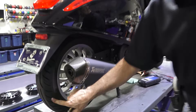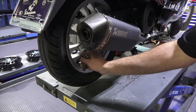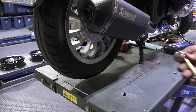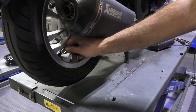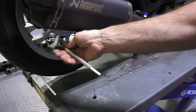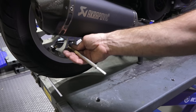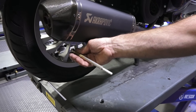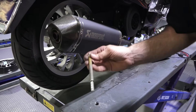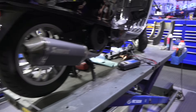I've got the part number for you. You've got the Schrader valve, much like a bicycle or a car. Unthread the little cap and just take one of these gauges and push it right on. It's got 26 PSI in it. On the nameplate it says 36. I tend to like to run about 32 to 34 with a single rider on the Sprint — that's on the rear tire. So I'm going to go ahead and air that tire up and go to the front.